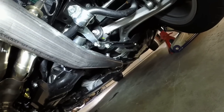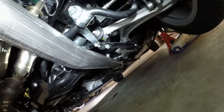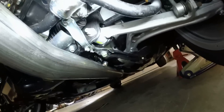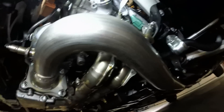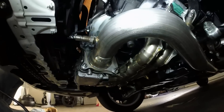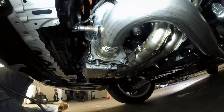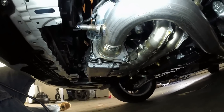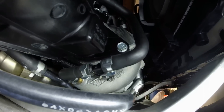The donut is tightened to 13 foot-pounds with the adapter donut kit, which is like 40 or 50 bucks extra to give it a real nice swivel. I've got the bung plug in the middle O2 down there. I'm going to put on the undercovers and flash it to stage two and be done. And don't forget to remove your restrictor pill with this downpipe install.